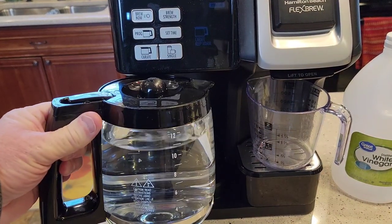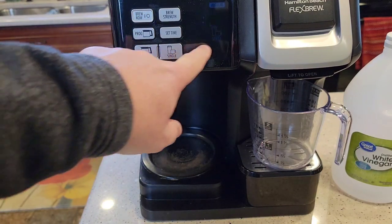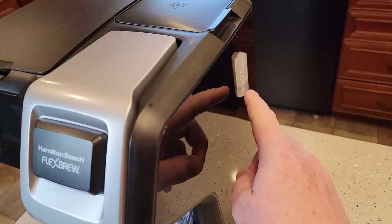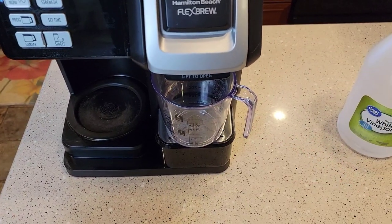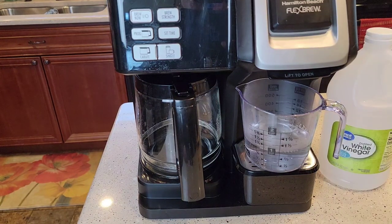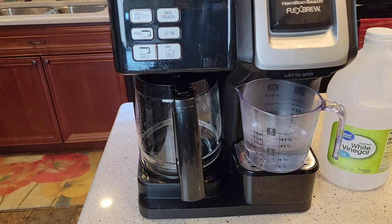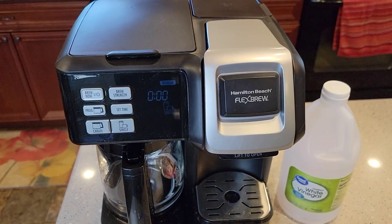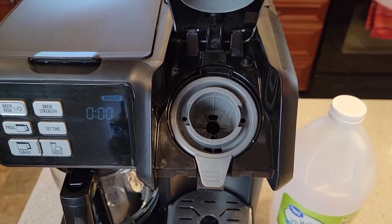I've run two pots of fresh water on this side, and now I'm going to switch over. I'm going to go dump this out, turn the coffee maker off, switch it to the single serve side, and turn it back on. That's going to heat up that vinegar again on this side — I haven't touched anything, I left it closed. I've got my container down here. It's going to finish brewing the rest of that vinegar through. The vinegar is out. I'm going to throw this out and rinse it with soap and water. Then I'm going to fill it up with 14 ounces of fresh water — that's the maximum this can hold on this side. Open this up and just make sure the needles aren't clogged. If you've got some big calcium deposits, they could clog the needles. But everything looks good.